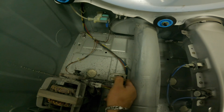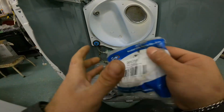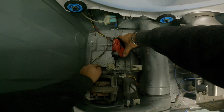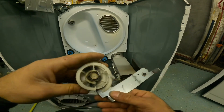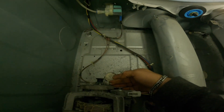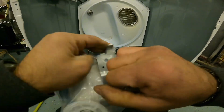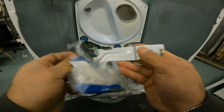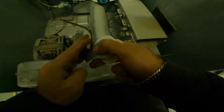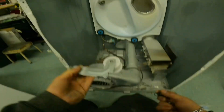As I'm laughing, I look over to the side and I notice something else is the problem — it was the drum roller wheel. But no problem, easy fix. There's the part number if you ever need to order one. These are actually upgraded and they come with a bearing — they'll most likely outlast the dryer and they're way cheaper than the Samsung original part. The old pulley most likely got stuck and jammed up, eventually the belt slipped off. It's a miracle it didn't break. I ordered them in bulk, at least 20 at a time. Once we unpackage it, we're going to grease it and install it. Check out the new bearings. We need that spring to keep the tension on.